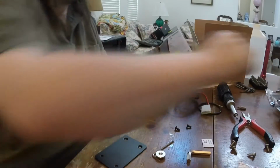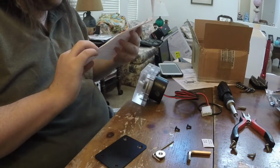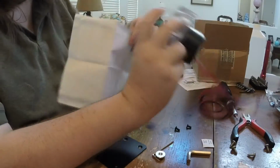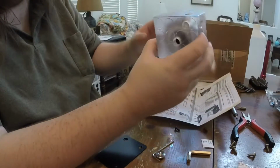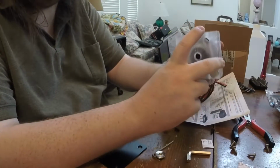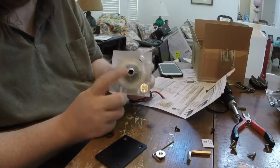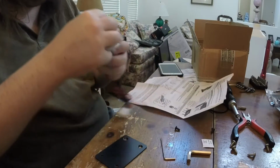All right, so the reservoir will come in from the top, either this inlet or this inlet. Then the exfiltration will be from this inlet. I would suggest that if you want to have your loop be faster, you go in here and out here. But if you want more of a centralized reservoir instead of it just coming off like a tank reservoir, you can go off the center, which is what we're going to do here. So I'm going to put the plug in this top one right here.